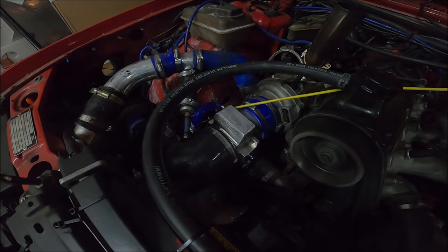But that's what driving it will tell me. The second issue, which is a common rumor, but again, nobody, to my knowledge, has ever tried it to find out, is it going to suck all the oil through to the compressor side when you let off the throttle off boost and make the exhaust smoke like crazy and fill the boost pipes full of oil? I don't know. Everyone gets that idea from the draw-through turbo setups. But that's with just the single throttle blades before the turbo, not one at the standard place as well on the inlet manifold. So in my head, in theory, and Thomas said the same without even me mentioning it, potentially it won't be a problem with a second throttle in the conventional place. But I don't know this, and I'll see.